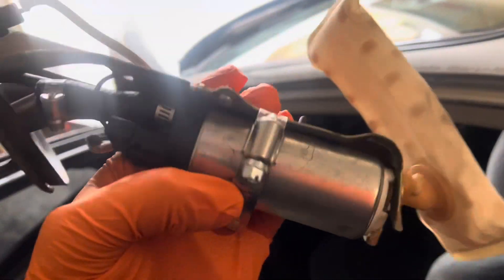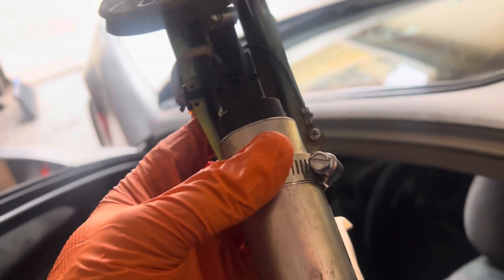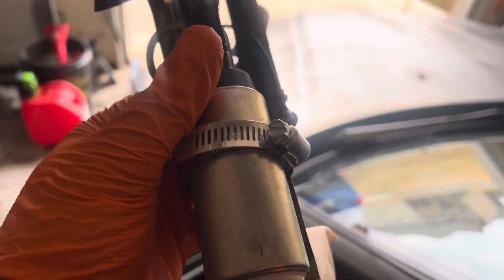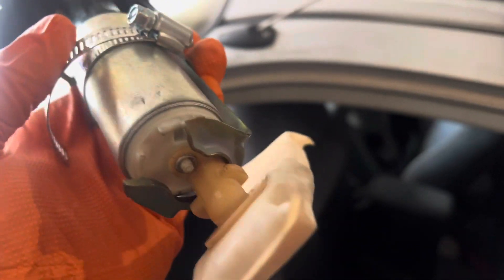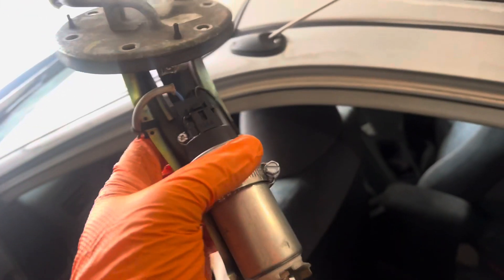So this is my little kind of rigged-up thing because I didn't want to use the zip tie since I plan on using E85. This is my Walbro 255 fuel pump. It was a direct plug and play — I just removed the old one, put the new one in, the connector snapped in. Pretty simple. Walbro 255, stock filter, stock housing, no modifications really needed.